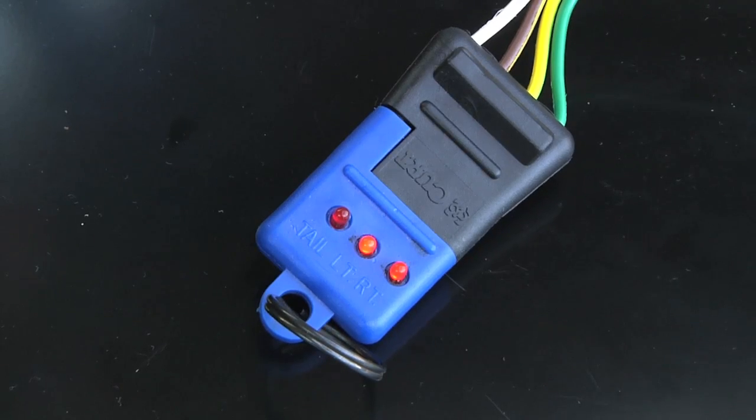Here's the brake light — I'm going to pump the brakes a couple of times. I'm going to turn the headlights on; the taillight should be lit now. Now I'm going to turn the headlights off. Left turn. Right turn. Hazard lights. And then I'm also going to test all those with the headlights on: right turn, left turn, hazard lights, and brakes.